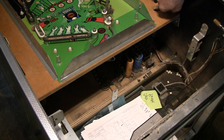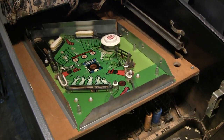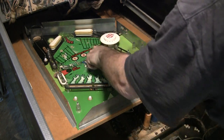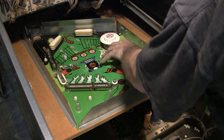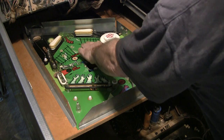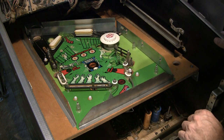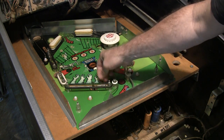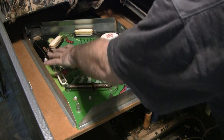Then you've got this lower playfield — I think it unscrews and pulls out. I've started to take the plastics off of it and clean it up a little bit. There's some wear around this pop bumper here, and some wear where the ball drops down into the playfield. Some of this is old because there's a piece of mylar around this wear, so somebody has already done some work there. I'm going to clean this up and wax it, and I'm putting new rubbers — a combination of black and white rubbers because I don't have everything the same size, but you won't be able to tell when all the plastics are on.